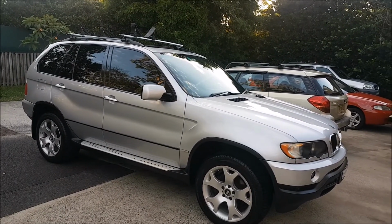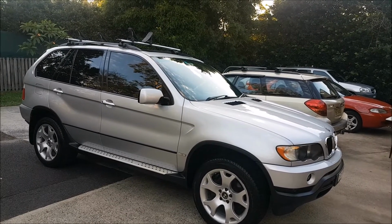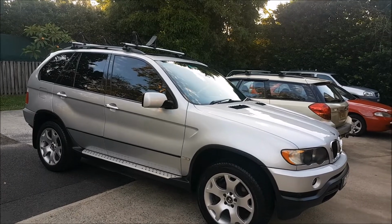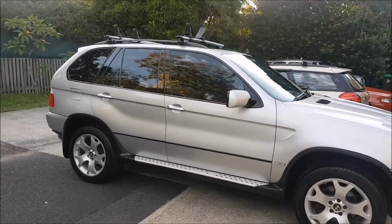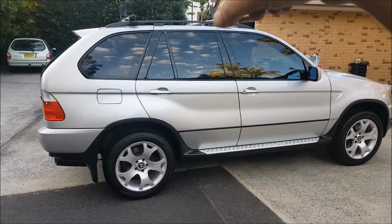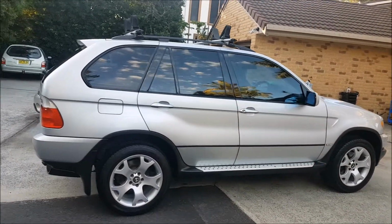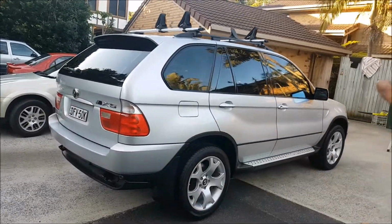Then I did an IPA wipe down, then polished the car using Flex Rotary 14-2, a soft polishing pad, or we might even say a finishing pad, and Car Pro Essence. All I wanted to do, there's no correction with this. It's only about gloss. So zipped around the car with the polisher. Also polished the B pillar, C pillar, and D pillars. Polished the rear lights and headlights.